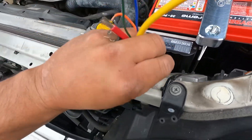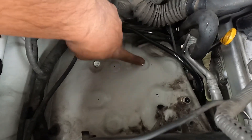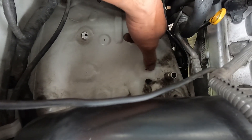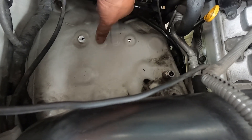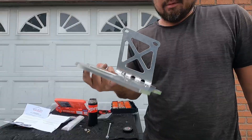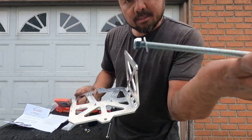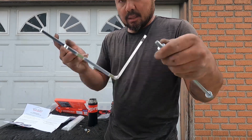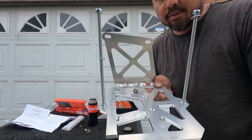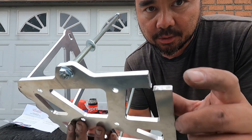The main battery is now installed. We have the wire ring for the BCDC charger right here. I've already drilled one hole right there, and all you got to do is mark the center of these flat spots — these round flat spots — and drill holes right there. You need four total. Before we get started, the first thing we want to do on the second battery tray is mount the battery tie-down bolts onto the tray. I had to cut out a section from the battery tray — I'll show you why in a minute.